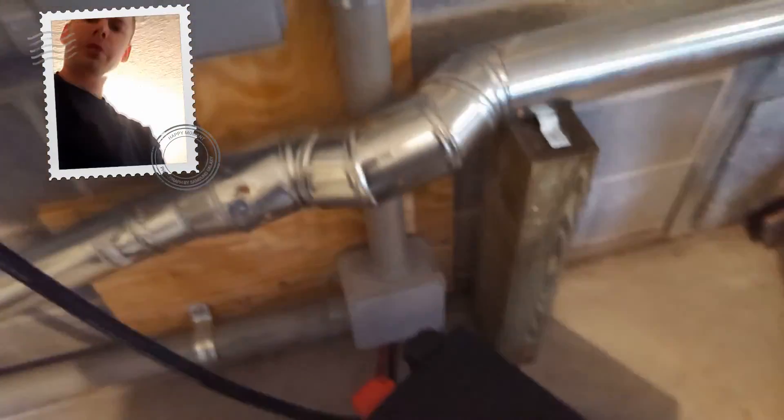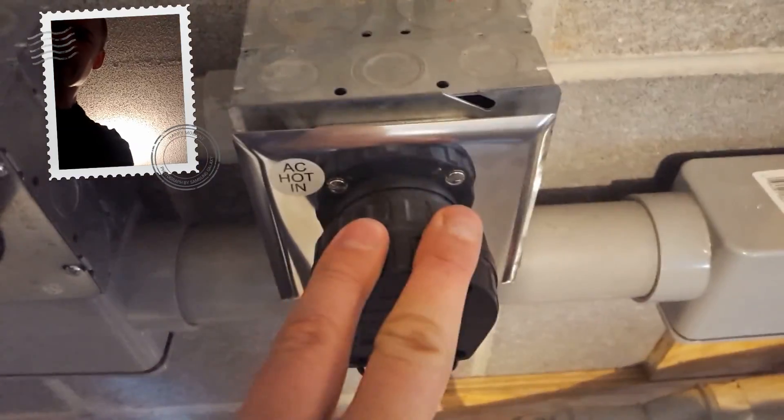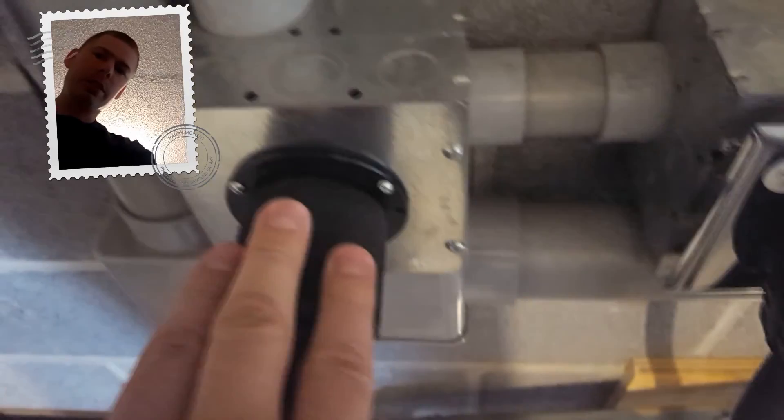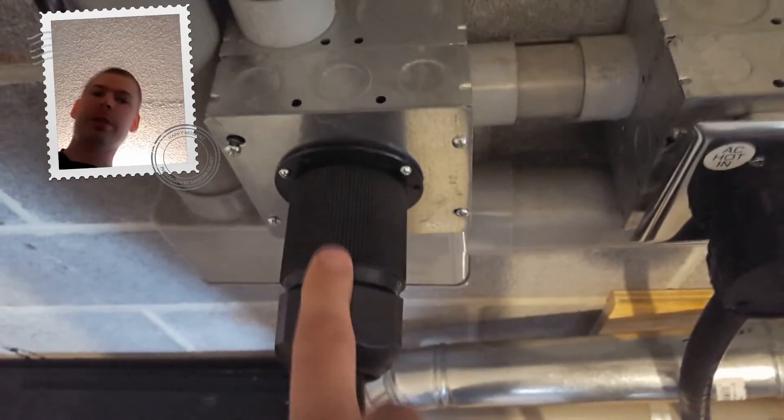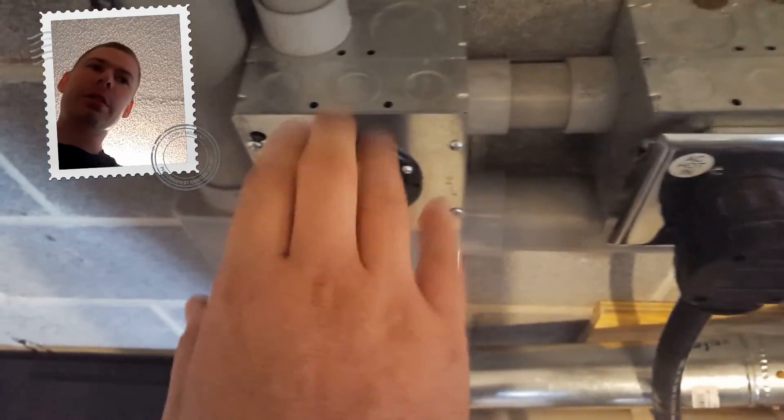Here's an overview of the power inside. We've got our wires that come down, then two wires go to the battery box and two wires go to the inverter. Taking a closer look here, we've got a range connector and an RV connector. This device allows me to pull it out — there are no terminals exposed on the outside of this connector. Since the inverter outputs power, I didn't want a range connector outputting power, so I made my own RV connector. I just unplug it whenever I'm not using it.